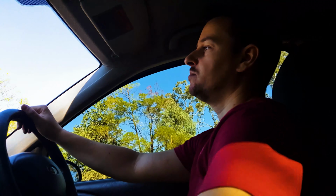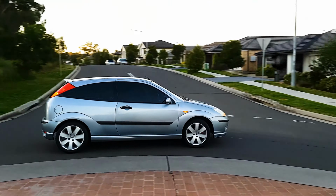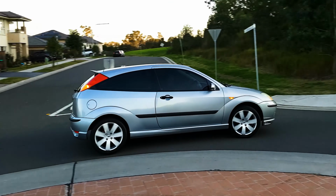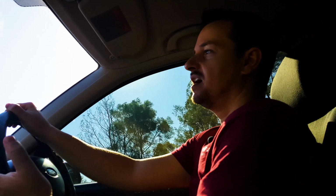And what that will do is warm up the oil in your car, so that when you crack the oil sump and drain it, all the oil will come out a lot easier. So think about oil like honey or butter. It sticks to things, and the warmer it gets, the easier it flows. So you want it nice and warm, so that when you pour it out, it comes out nice and easy, and most of it will come out. You won't have large parts of it sticking to your engine and staying in there. But really, this only takes about 5 minutes, and then head on back and get started.